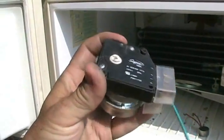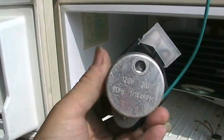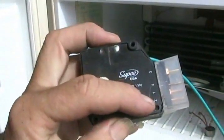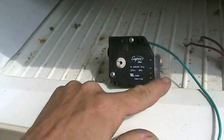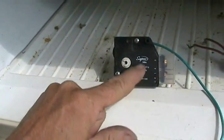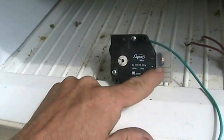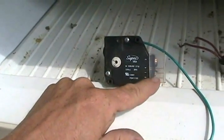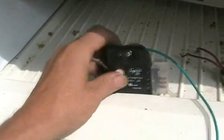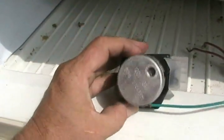And there's a timer. It uses just a little clock motor — a 110-volt AC clock motor. Inside there are two sets of contacts: an input pole and then a switch that swings one way or the other to make contact on two terminals. That's the center terminal, and the other terminal is the neutral terminal just to run power to the clock motor.